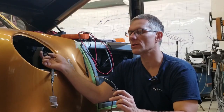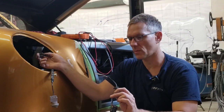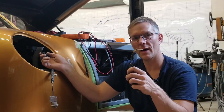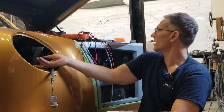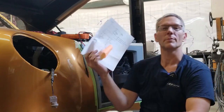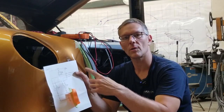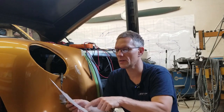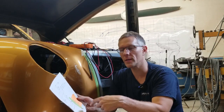You can go ahead and try guessing which wire is going to work with what. Green and white — the closest one is white and blue. It doesn't work. We have to figure out what wires are the high and low beam as well as ground for the Mini Cooper, as well as the high and low beams for the Mustang. And that's where these pieces of paper come in — they have these little lines drawn all over them. They're called schematics, wiring diagrams. This is what we're going to be using to work one harness into the other. This is the Mustang schematic, and these little notes here are for the Mini Cooper — figured out which is high and low beam.